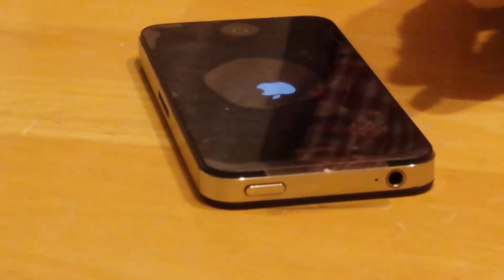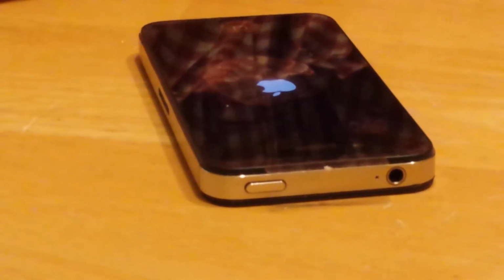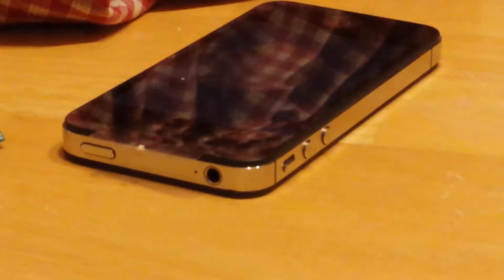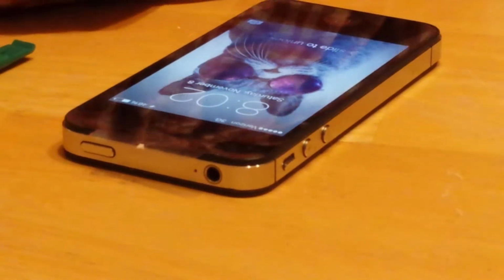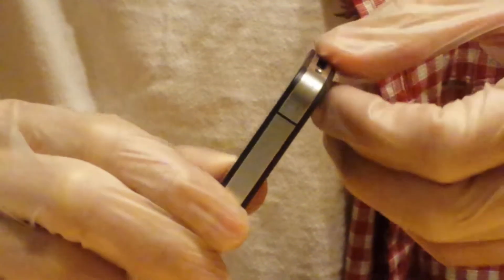And then the last step is to put in the 2 screws that go into the bottom. So I'm going to go ahead and get those bottom screws out. And again, remember you want to use that special screwdriver, the 5-point screwdriver. You stick the screws in there. Remember, go backwards before you go forwards, and don't tighten it down all the way until you get the other screw in there.